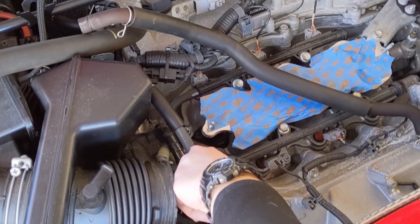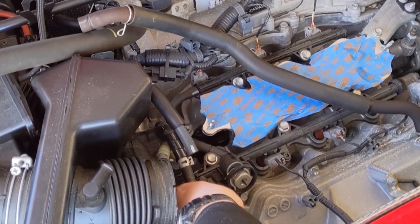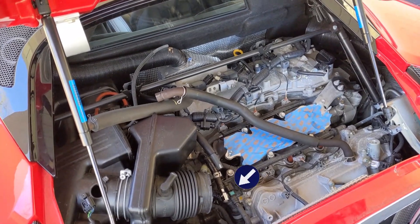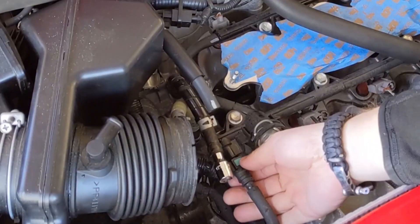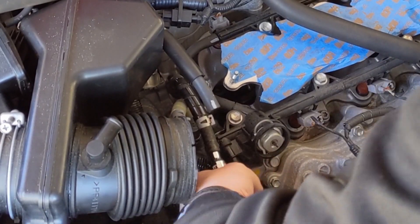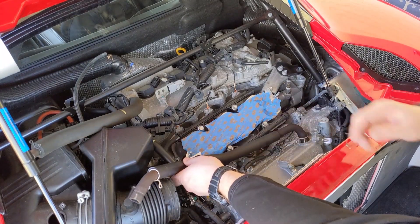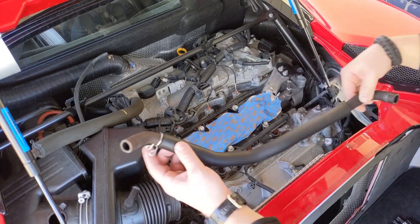We're gonna be working on the fuel rail here. There's a little plastic protection on here — you don't want this coming off by accident. That slid right off. It was put in from the driver's side towards the passenger side. To disconnect the fuel rail, you'll see that green button — press on the top and the bottom at the same time, squeeze and pull it towards the rear of the vehicle. It's off. A little bit of fuel came out, just like an ounce or two, and now it's stopped. Just gonna move this out of my way and disconnect it. Take that back, which is a little clip, and then just gently wiggle it. Very nice, easy enough.